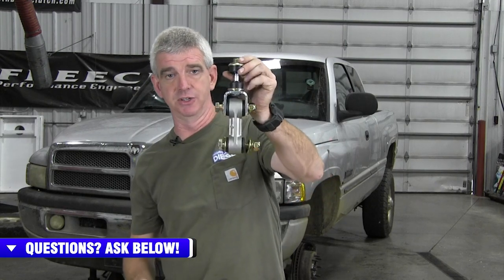Another thing that's nice is this is a huge upgrade when your truck is on a two-post lift and all the weight of the axles is pulling on this. This is a much more robust unit than you're going to get with your stocker, so it's not going to stretch and manipulate it to where it's deformed and no longer able to function as a sway bar end link.